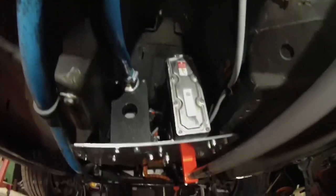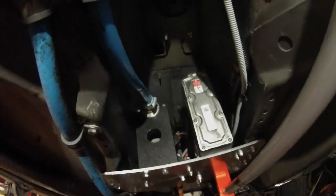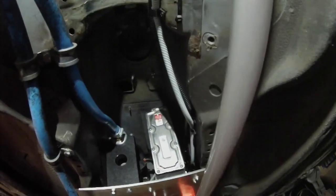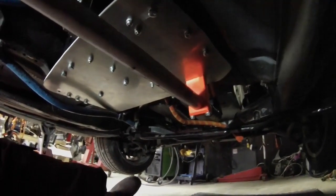That's our Volkswagen heater mounted here. That's the LIN bus controlled one, variant or whatever you want to call it. So all that's mounted on our aluminium plate, which is bolted up here where the automatic would have bolted up. This big pipe here, that's a PTFE tube, that carries the high voltage lines from the rear of the car up to the battery in the front. And of course, our over the top 3D printed bracket for holding that on here.